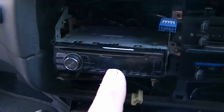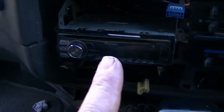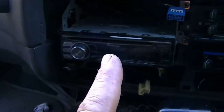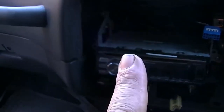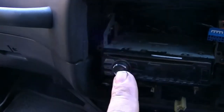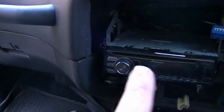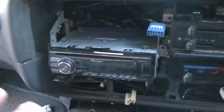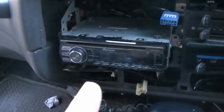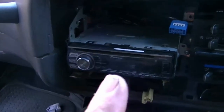I found the short. It was essentially a combination of the left-hand front speaker positive out and ground from the head unit onto a metal bar just on that side of the center dash — all shorting out on that side. I would have thought that shouldn't have had anything to do with the cigarette lighter, but somehow it has. I think it's only the lights that are on the negative side of the harness, but this has proven to be a goddamn nightmare.